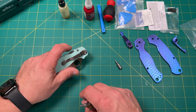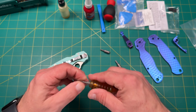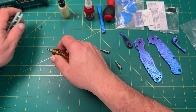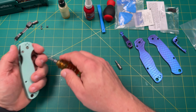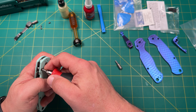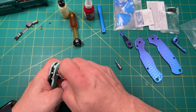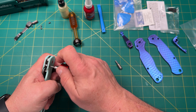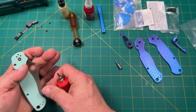The only thing is these are T6s — just so you know. Get off the clip first. Sometimes if I can't get just enough leverage, because I don't want to strip it, I get in here and push a little harder with the stubby. I don't want to strip the screws and get it stuck — that's why it's always nice to have a stubby. Sometimes they're in there a little tight. You'll notice there's probably some Loctite — yep, there is some Loctite on that for sure.